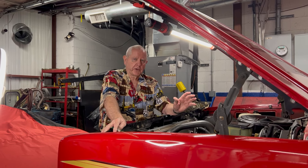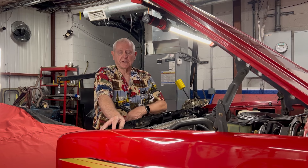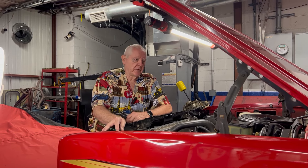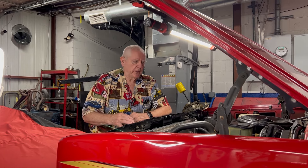The first thing we discovered was the transmission was shifting very quickly. You'd take off and before you knew it you were already in the last gear, and then it went into lockup. This transmission has the old overdrive with a lockup on the torque converter, and it was done shifting way before it should have been. So the first thing we did was adjust that so the shifts were later, catching the torque band of the motor and making it shift more smoothly.